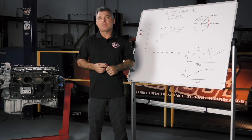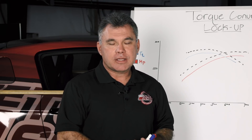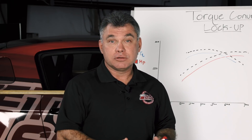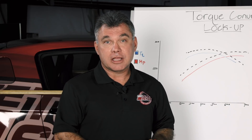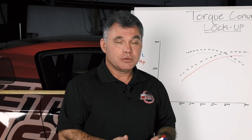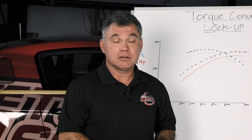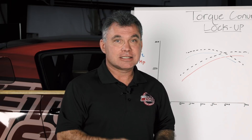A couple of examples of when we would want to lock up the torque converter. One extreme example is a converter that's too loose. We had a car in South America where the owner didn't want to send the converter back even though it was too loose. We determined that locking up the converter in second gear was the optimum. He was able to make it down the track without hitting the rev limiter, whereas with the converter unlocked it would hit the rev limiter. We tried third gear, we tried other options, and determined his car was perfect to launch, knock into second gear, and lock the converter as soon as it went into second gear. It lost a little ET but he made it down the track consistently every time.